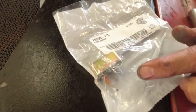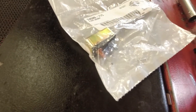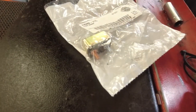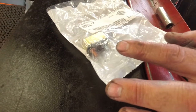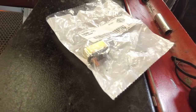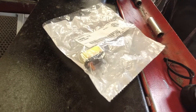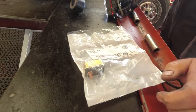You can see on this one there's a two-colored terminal — you've got a copper terminal and a standard steel terminal. It does have an orientation, so when you fit it you must make sure you put it the right way around. The main power comes to the copper terminal first, so just be aware of that when you take it out. It's quite common when you take it out that it's all corroded away and completely fallen to bits. I've seen these on a two or three year old bike and they've been in pieces, just rotted away completely. If you ride in all weather, they just rot away completely.